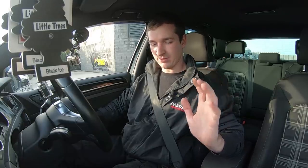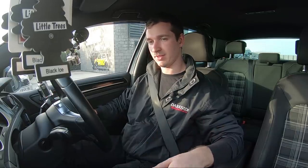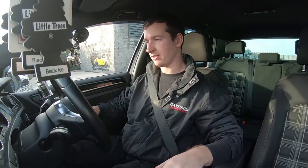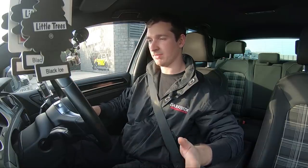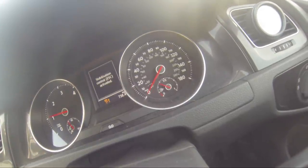So neutral, handbrake on, ignition on. Wait till the alt lights have stopped doing what they're doing. Hazards on. Accelerate all the way down five times — dyno mode. Now if I set off, that should just go off.